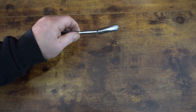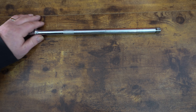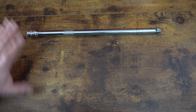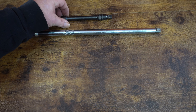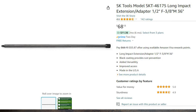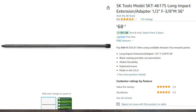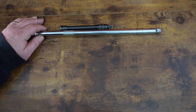I'm using half inch just because it's exaggerated for the camera, but they come in quarter inch, three eighths, et cetera. One thing that has definitely fallen off for me is impact extensions. I literally only occasionally use locking extensions that are impact rated. The only common impact extension I now use is a 36-inch impact extension reduced to three eighths on the other end, or a straight long half inch 36-inch for transmission bell housing bolts. Everything else I use is generally Chrome.